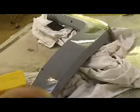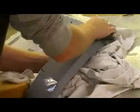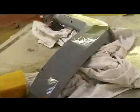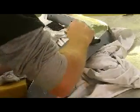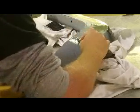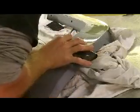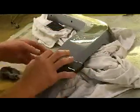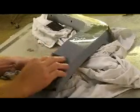Here's something in that. I noticed when this primer was going on that it was leaving some splatters on me. So it looked like there was dirt in it, but it's not dirt, it was just little chunks of primer. I like the product, but it's certainly not without its flaws. See just a tiny bit of guide coat left on that line. You just want to refine those scratches a little bit. It is black.